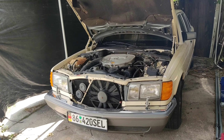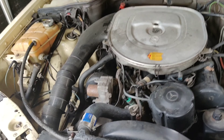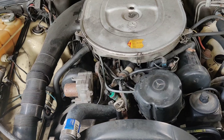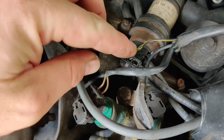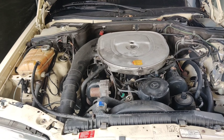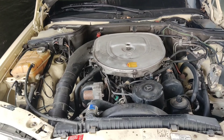So I needed to fix these little issues. Today we're going to tackle the issue of a high idle, and I believe I know exactly what's causing it because I just searched around the IAC, or idle air control valve. This is a very common issue for a high idle, so it was the first place I looked, and immediately I saw this wire coming completely out. When you have a high idle or an idle issue and you believe it might be the IAC, the best thing to do is start looking at all of the electrical connectors — make sure that the connectors look good and then go from there.